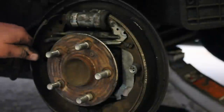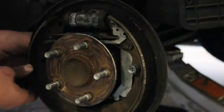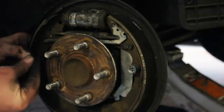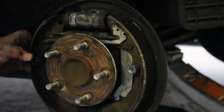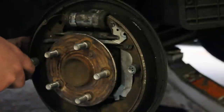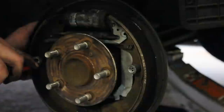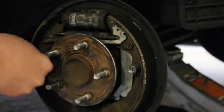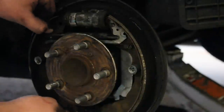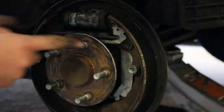Now I'm going to find my other pin — we're going to take that other pin and stick him through the hole on the other side, through the backing plate, just like that. Just like the other side, I'm going to set the spring right there and get my tool set up. We're going to push down, just trying to work the pin in there. Got to make sure the spring is straight. Both my springs are looking good. Now I'm going to make sure everything's in each little slot — looking good. Now it's time to put the spring up there and the spring down at the bottom.